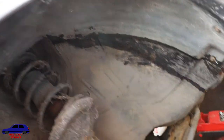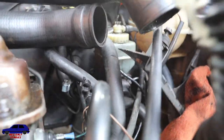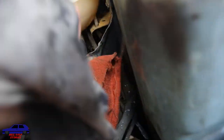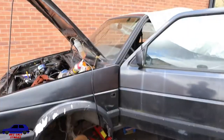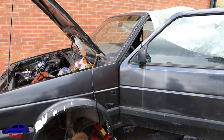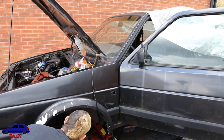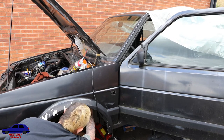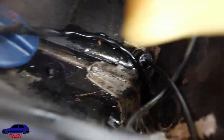It seems to have a lot of brake fluid coming down from somewhere. Let's figure out where that's coming from. Running down some pipe or something. That's what I'm thinking. There's the pipes from the cylinder itself. Ready? Yep. Really? Oh, maybe. I don't know, it's hard to tell. Panic over. It was just the brake fluid here running down the drain hole, although we do need to wash it out because this stuff will rot paint.